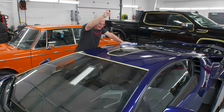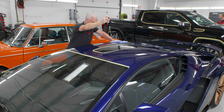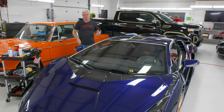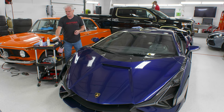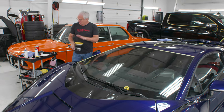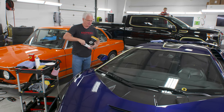I'm going to look at it again — yeah, I'm really good with how that came out. So if I'm good with that, then I'm going to go immediately into a test section right on top of that with my normal finish polishing process, which is typically the yellow Rupes pad and Sonax Perfect Finish. I'm going to verify that is going to work as it normally does, and once I'm sure of that I'll continue on with the rest of the car.